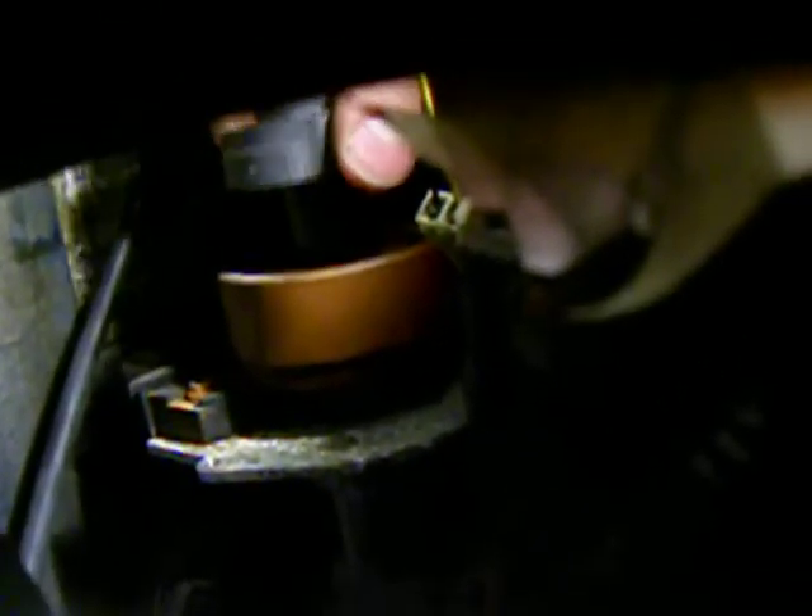If I put quite a bit of torque on the distributor, it doesn't seem to slip its teeth, so I'm guessing the gear's probably not stripped. But maybe the bushings are worn so bad it's allowing the shaft to ride up and change the timing, and that's enough to cause it not to start.